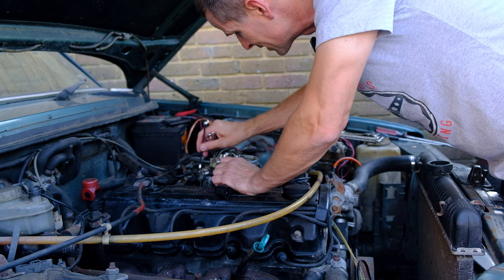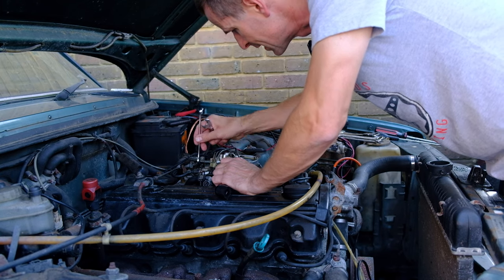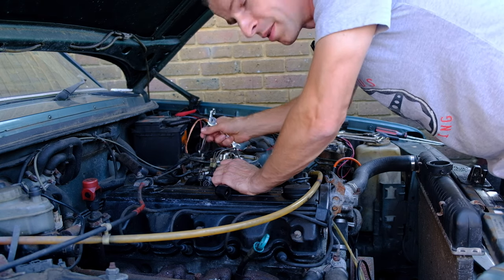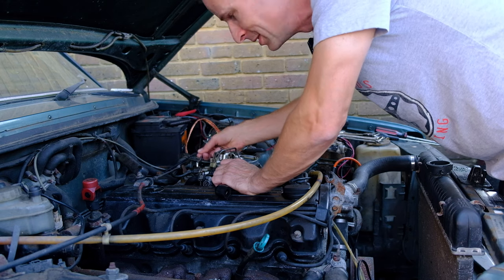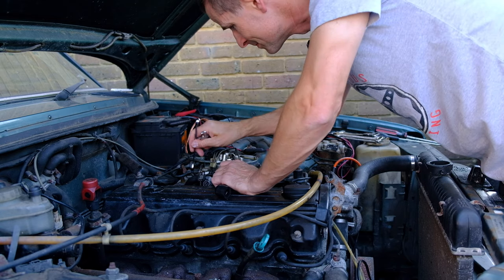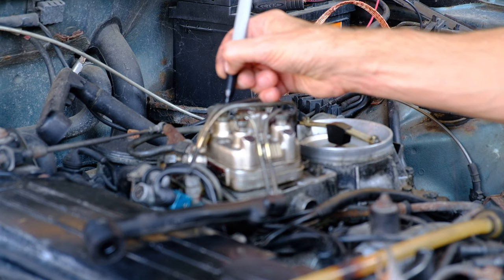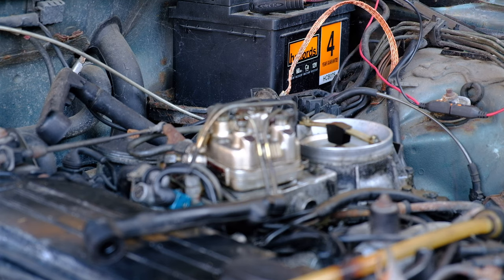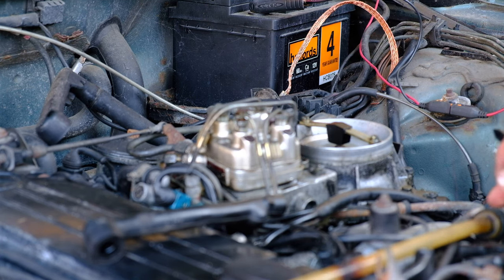First of all, I'm disconnecting the inlet and outlet pipes to and from the fuel tank, and obviously the injector lines as well. I will mark them as to which one goes where, otherwise I'll have a problem. Then it's 3 screws, and this thing should just lift off. That's just clockwise, 1, 2, 3, 4, just so that I know which one goes back where when I'm done with it.